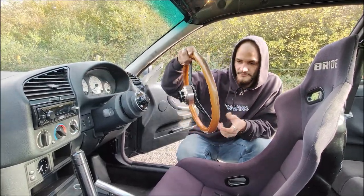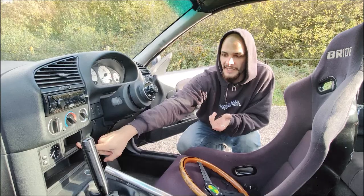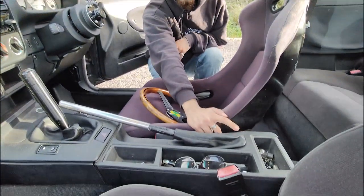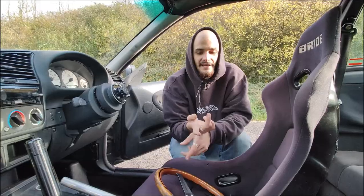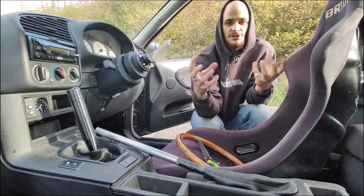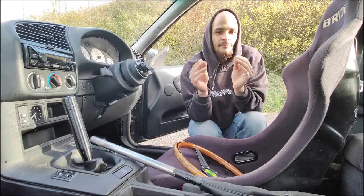I have Lockwood white-faced clocks from a 328, which works well with the engine. There's a CD player, an eBay shift knob, and the 325 donor car had this no-armrest ashtray-delete center console — which is exactly what I'd been looking for. Handbrake doesn't work — I need to sort the shoes. Chelsea DeNofa is the genius on stock handbrakes: service it, put nice shoes in, tighten it up, and it works.